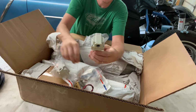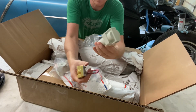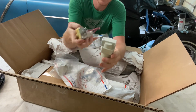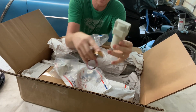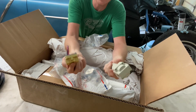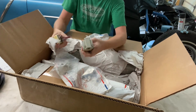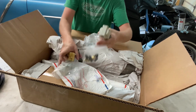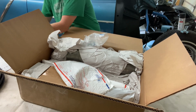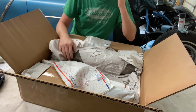I'm gonna feed my air compressors into these. I got 2 of them. It's always smaller than you expect it to be. So 2 of these are gonna attach to the tank. Air compressor goes into the tank, and then these bottom pieces are gonna connect together, and then this is gonna be my dump. So if this collects water, I can just dump it out underneath the car. I don't actually have to check the tank near as often. Oh man, I'm so excited about that. I thought about doing a manual valve, but truth is the price difference for manual versus electric wasn't that much different.